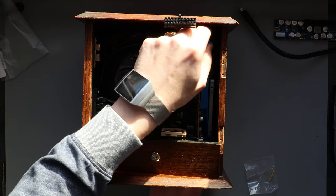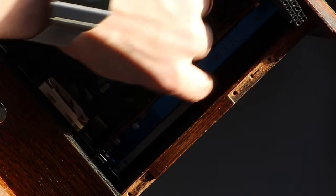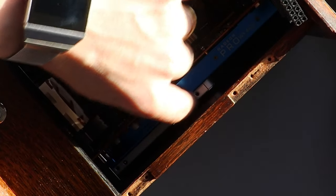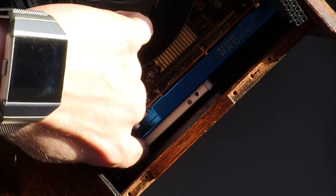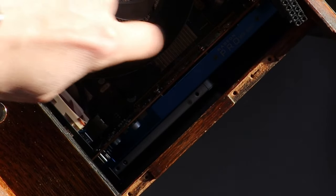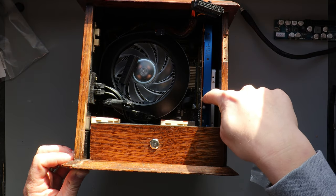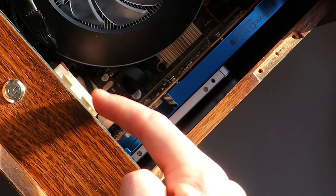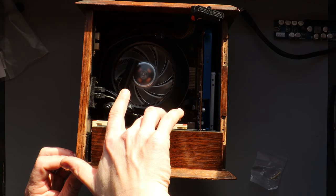It is a very snug fit, but it does fit. I've got little pads on the SSD, so he sits in there and he doesn't move, he's quite sturdy in there. And the added advantage here is any heat from here will get transferred into the metal casing of the card, and there's an airflow that comes from the back of the card through to here, and it'll be pulling air past the SSD at the back, running it through the inside of the card and pushing the air out at the top here, which hopefully can get sucked out of the case by this small fan here.